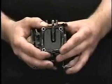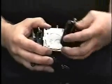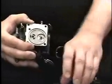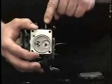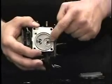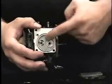What happens is this: the piston goes up and creates vacuum in the crankcase. That vacuum is transferred into this chamber here, which is the pulse chamber, and your pump diaphragm. That will pull the diaphragm in, which allows fuel to go past your fuel inlet fitting, past your fuel inlet check valve, into your pump chamber.